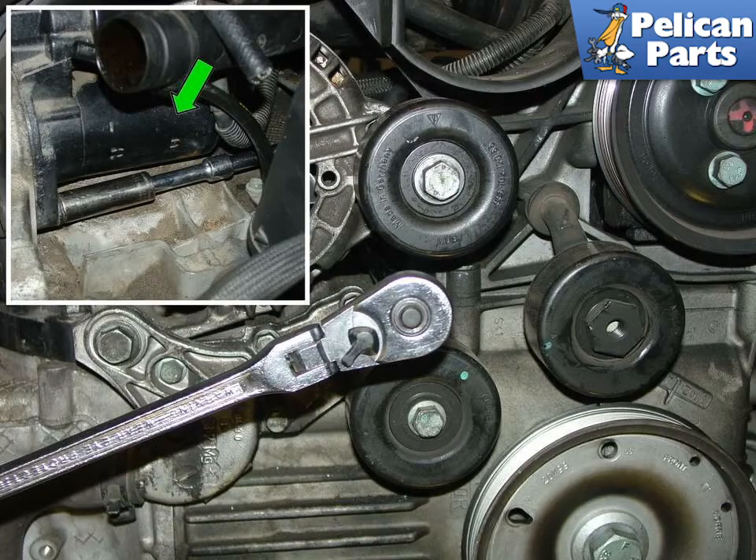I found it very difficult to reach one of the lower starter bolts from the top of the engine compartment. To solve this problem, I removed the cover behind the seats and used some very long extensions to reach the bolt. If you need assistance with removing the cover behind the seats, please follow the link provided at the end of this video for assistance with that task.